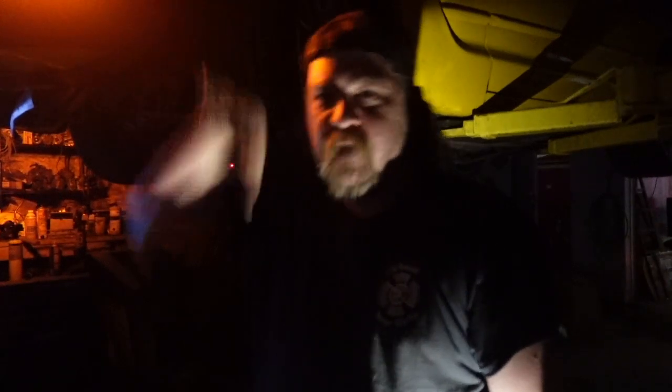So hold on, let me get you on a tripod. Let me lower the car, check up top. Whoa, let me lower the creepy lighting. Let me lower the car, check up top, see if I got anything glowing now, because like I said, the one line on passenger side is above the pan, so it's coming down from there. So valley or, you know, whatnot. So let me get this thing down some and scan up top. But it is definitely a pressurized leak.